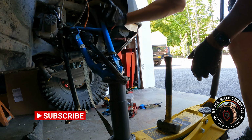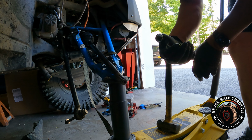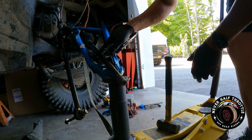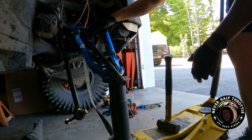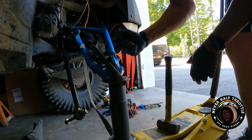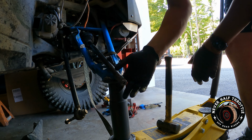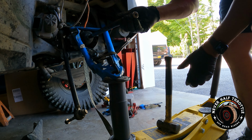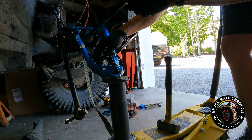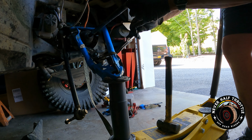Now, it wouldn't come out. Several times, several occasions, it wouldn't come out. So what I decided to do was reinsert this part of the axle back into the part that's stuck inside the bell, that's stuck inside the front diff. Once I had a lot of tension on it, take this shaft, 4-pound mallet, bang on the back of the shaft with the strap under full tension.